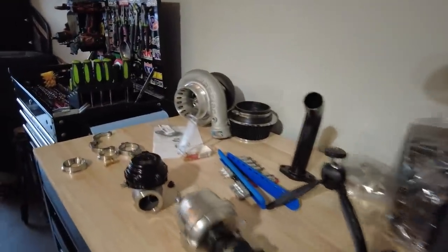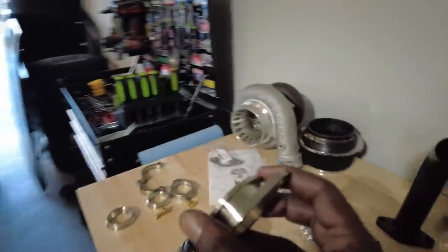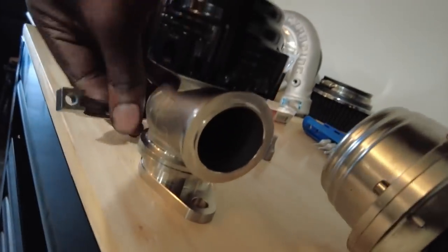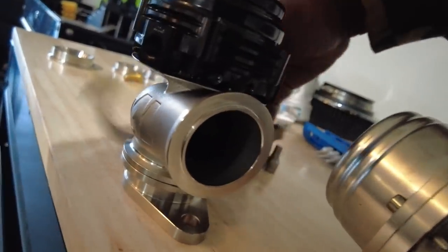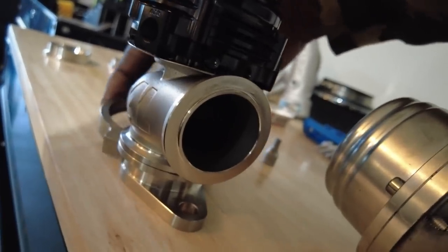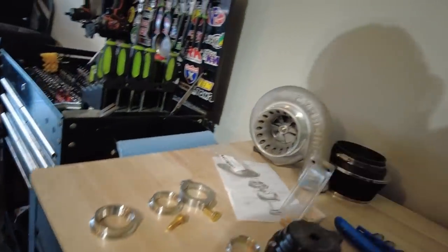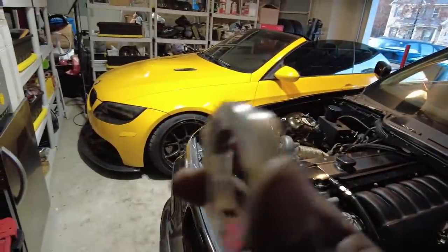We're going to swap this out and make this a two bolt flange that mounts to that two bolt. Then this goes in right there, and I can V-band it together. That solves a whole lot of issues, and if I need to make changes, it won't be such a pain because it will just V-band right together. But the adjustment I need to make on this is that it's supposed to be V-band, and it's kind of shaped funny. On a regular V-band, here's the one that it came with, a V-band ring, something you can weld onto if you need to.